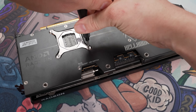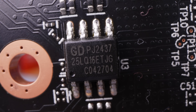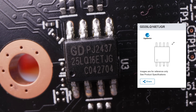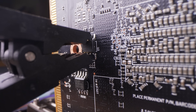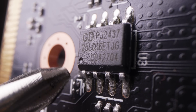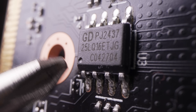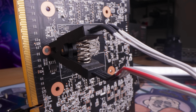Flashing the BIOS is pretty simple, actually. You take off the cooler and the backplate, locate the BIOS chip — it's the only chip with its form factor, a chunky rectangle with eight pins on this card at least. Then you attach the clip from the USB CH341A programmer kit and flash the BIOS with a programming utility like Neo Programmer, which is what we used. Make sure you're orienting the clip correctly — there should be an arrow on the PCB and/or an indent or dot on one of the corners of the chip signifying pin one. And use the correct voltage with the CH341A — in this specific case, our BIOS chip operates at 1.8 volts.